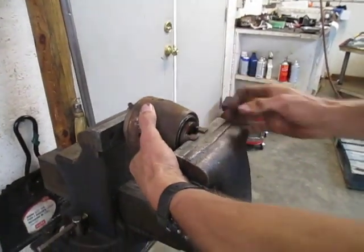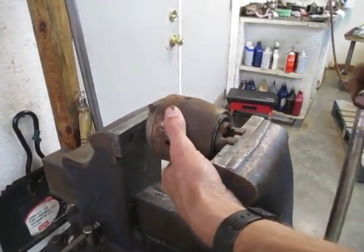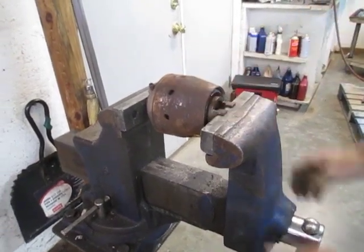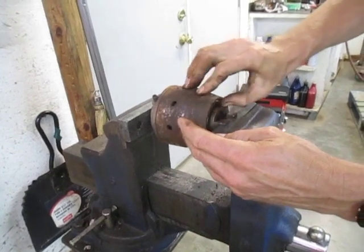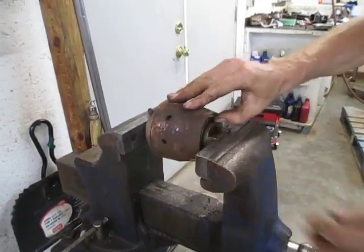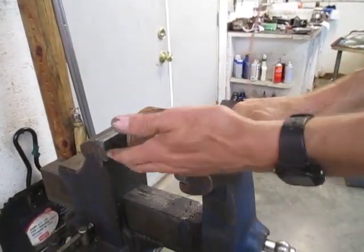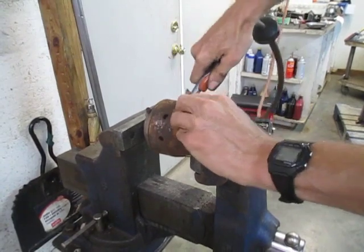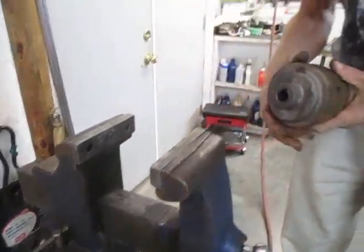When you let the clutch out, it's one solid piece. There's an enormous spring inside this clutch that's pressing the inner cone against the outer cone, and that's what transfers your power. Often one of these bearings will go out — there's a bearing on the inside and a bearing on the outside. The bearing on the outside is easily replaceable; the one on the inside, not so much. You have to send your clutch in and we can rebuild it. The factory does not authorize anybody taking these apart except dealers with proper training — they're not considered a serviceable clutch. So we've broken that clutch loose; now we're going to put it back together and put this guy back in service. Thanks for watching.